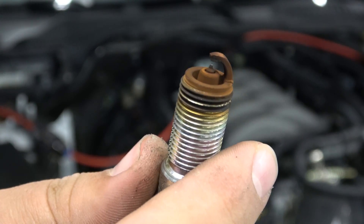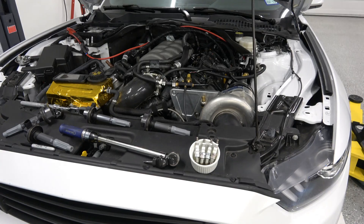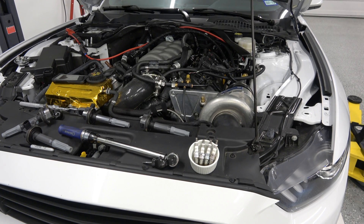This is the MMT contamination from the race fuel I've been talking about. Supposedly it's harmless, but I'm going to clean it up. I've got all four plugs soaking; I'm going to clean them up and put them back on, then load the new Lund tune. I found out what went wrong yesterday — he left a soft limiter at 6,300 RPM, so that's what I was bouncing off of during testing. Today I'm going to load the appropriate tune and give 7,200 RPM a try.